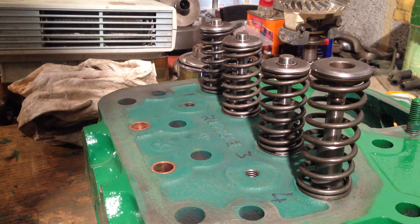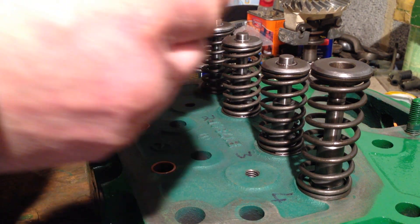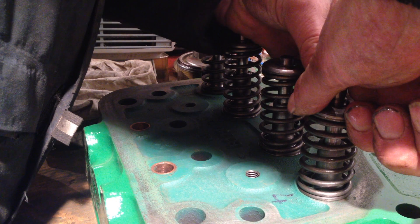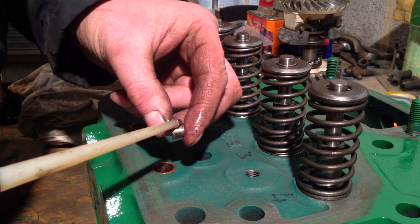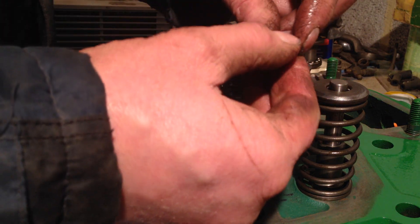Same trick again, just a bit of oil, push them down by hand. I do have a proper valve spring compressor but it's not big enough for these valves. Just push that in like that. You've just got to be a little bit careful that if you let go of the spring it doesn't come back and poke you in the eye - or worst case scenario, fling these little collets and bits all across your workshop floor. I'll speak with experience on both occasions.